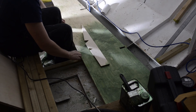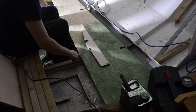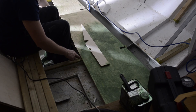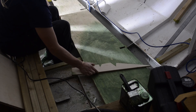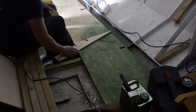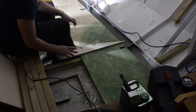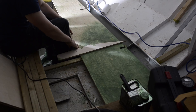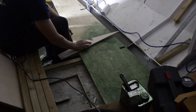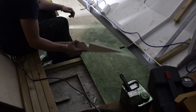Basically you lay down the straight edge where it's going to be in its final place — so this is exactly 280mm from the centre line, all the way up. What I'll do is put this down here, measure the corner up here and then profile it all the way down and mark on the template the shape of this stick. So when I put it onto the final piece of ply, I'll have an exact copy of the profile. It's hard to explain unless I actually show you, so I'm just going to show you.